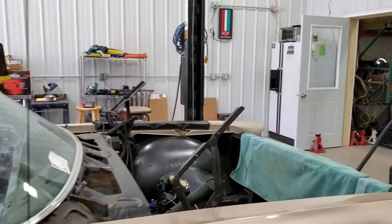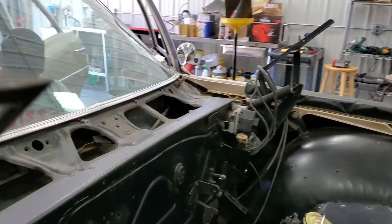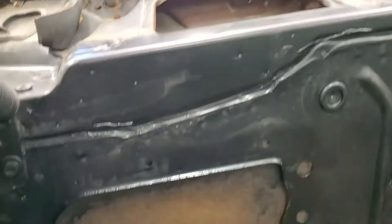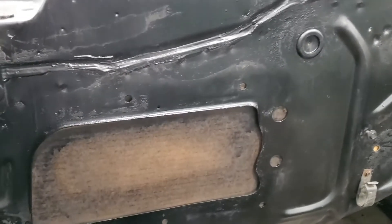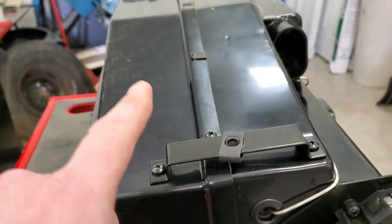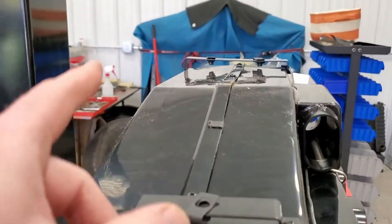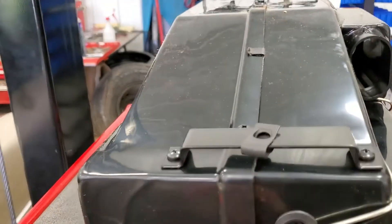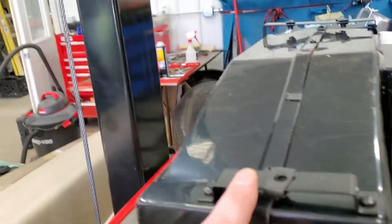Here's a trick — apparently not everybody knew this: if you want to know where holes are, you put your material up and then you just paint, and now when I take this cardboard down I'll know exactly where all those holes are. They're quite obvious. But we're trying to figure out what I'm going to have to do to make the bracket, because obviously those aren't even close to flush, so I'm just going to bend up a new bracket and drill some holes in it.